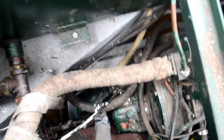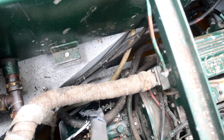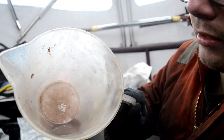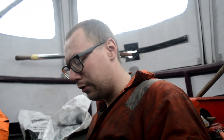The jug is underneath and is draining the oil out. I've just drained the gearbox oil and you can clearly see it is a little bit emulsified and there are some sediments in there as well, so it definitely needed to be changed. Automatic transmission fluid normally is a translucent red colour.